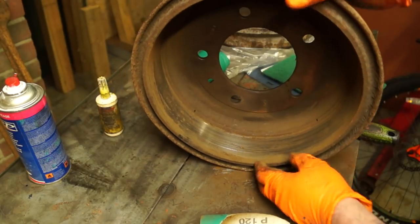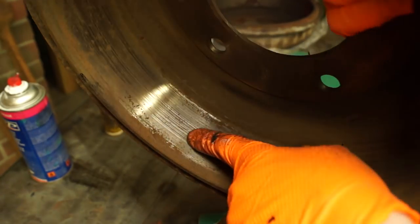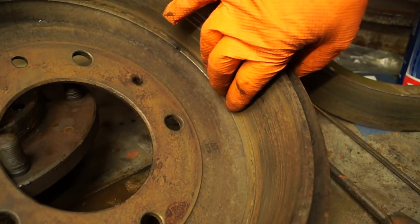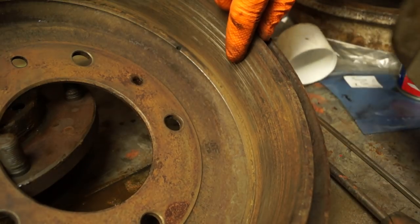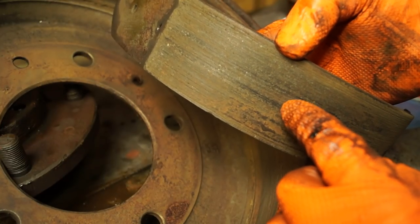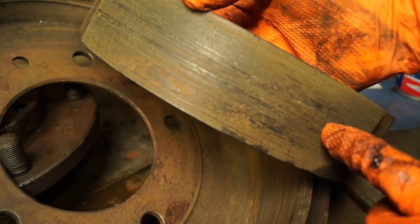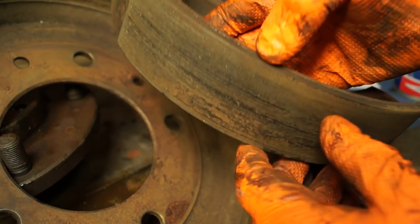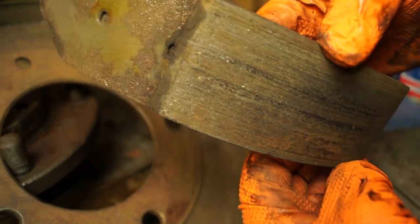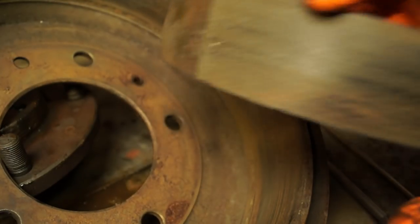Also the deciding factor — it's scored quite badly. You can see the scoring in here, it's fairly rutted. What happens is that the parts where the shoe bites in, which are lower, actually overheat, causing more friction and heat. The shiny black parts you can see are glazed — that's the higher part of the shoe surface. Glazing gives you a poor working surface on the brake shoe, so you can see how problematic this is if you want good brakes.